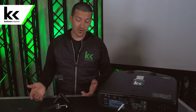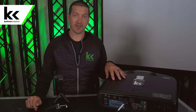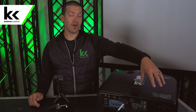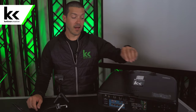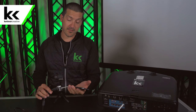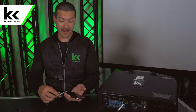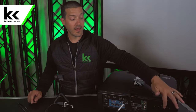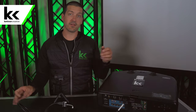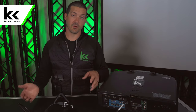It's important to note that by default, audio will come out of your iPhone through the HDMI cable into the back of the projector. So if you're showing video content that needs audio, you need to pull the audio out of the projector using a headphone output or something like that. Since there's no longer a headphone jack on the iPhone and we've already used the lightning output, we'll have to use the headphone jack out of the projector to connect to external speakers, or simply turn up the volume on the projector for the room.